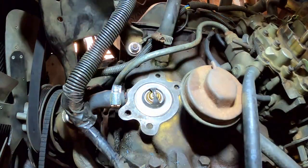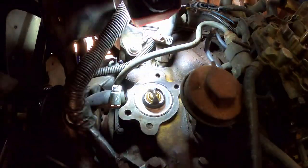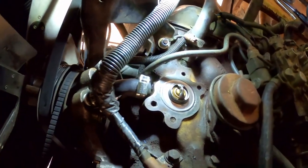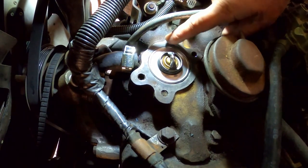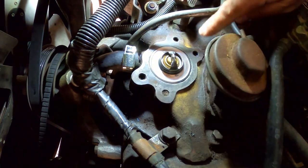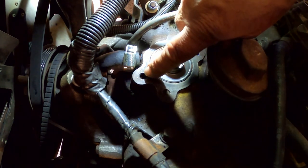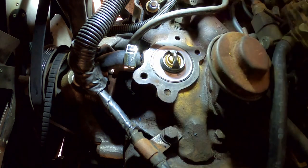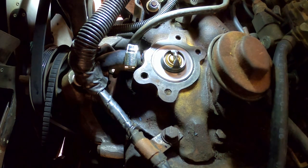Now, in a perfect world, which none of us live in, I would have a 3/8-16 tap, and then I could clean these in the best location. Let's get over here a little bit better. Okay, that'd be good enough. Can we see this hole over here? A little shadow going on here from the fuel line going up to the carburetor. I'd run the 3/8-16 tap in each of those holes and then blow them out with an air compressor. But I'm just going to have to rely on the cleaned threads. We did a 50% better job anyhow. So anyway, the thermostat is in there and it needs to stay put.